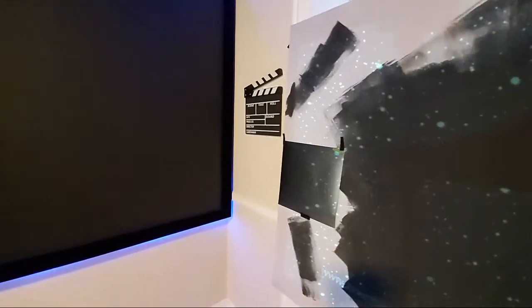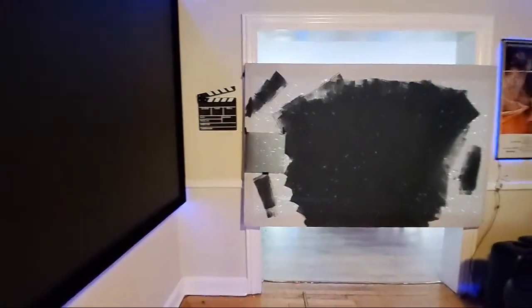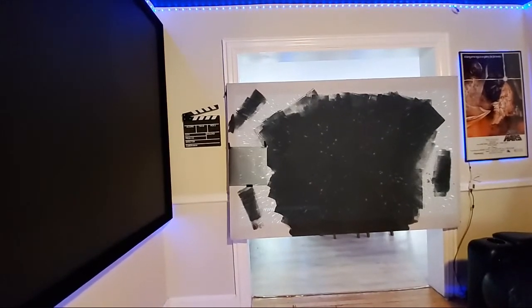So you can see my body's here, and I'm not moving in front of the camera. It's called the narrow viewing cone. That means the screen can only be viewed if you're standing right in front of it. If you turn to the left or right, the screens become dark on the edges. These screens also have a problem with ultra short throws. Any screen that has a reflective surface may have problems with ultra short throw and short throw projectors. That's why they have special screens developed for ultra short throw projectors. You will pay more for those too.